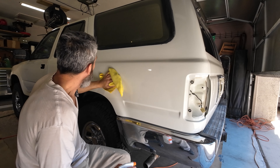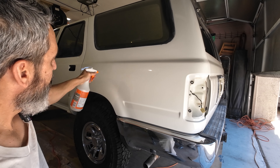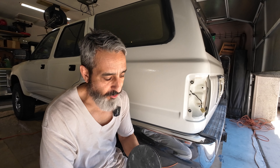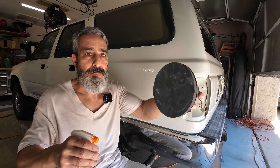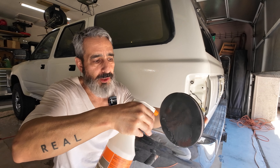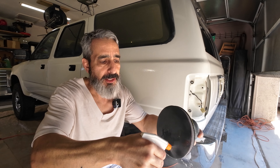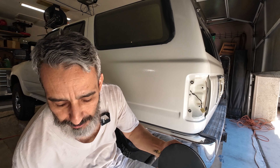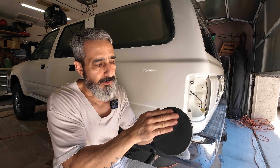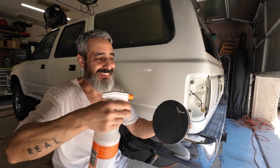So just be very careful with this step and make sure it's clean and ready to go. That's my second wipe down. My next step is to actually lubricate the whole panel with the same solution — water with a little bit of soap — and then lubricate the sandpaper. Since I've used this sandpaper on the previous panel, I hold it vertically and lubricate it that way. If there are any particles in there, it'll wash them right down and not scratch the sandpaper. I always give the sandpaper a quick feel too — sometimes you'll feel a little particle in there.